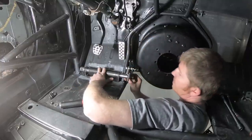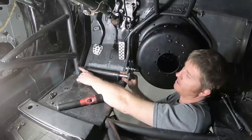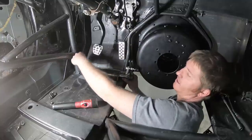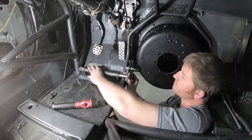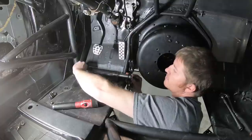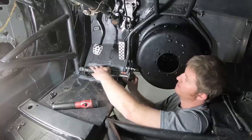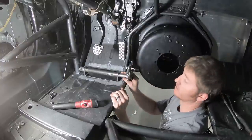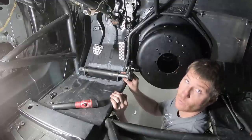It needs to be in just a little bit — about a quarter inch in. I gotta keep in mind where the shaft is on this side because the bolt needs to go through, and the pedal has to weld up on top and still have room for gussets. I have just a slight twist in that. There's a good angle — the head is where it needs to be, has a little flare, lock it tight. We're gonna take it back to the welding bench, tack that, bring it back in, check it, and if it's good, weld it up.